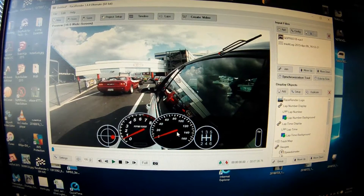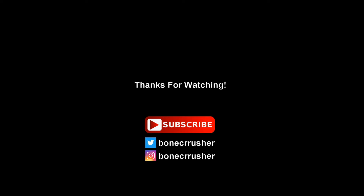The Torque application is also pretty robust — you can data log, do highway efficiency and fuel economy tracking, track your mileage, and clear OBD2 fault codes. I used mine to data log the Corvette because I didn't know how much boost it was making — I found out it's making about eight and a half to nine pounds of boost with the Edelbrock supercharger. So it's a pretty robust tool for just $13 if that's all you want to use it for. If you guys have any questions feel free to ask, please subscribe, and thank you.